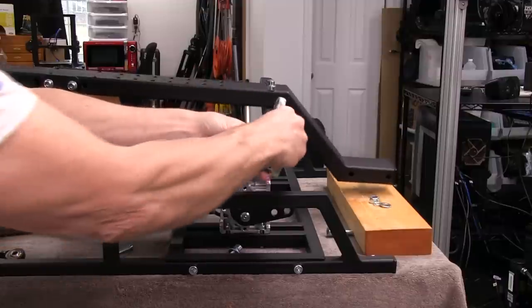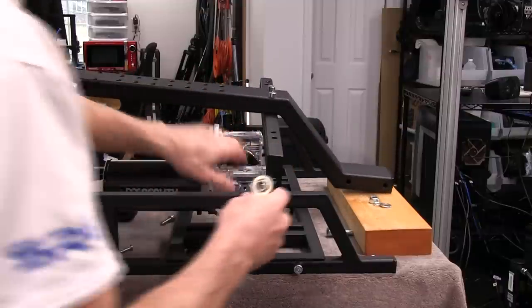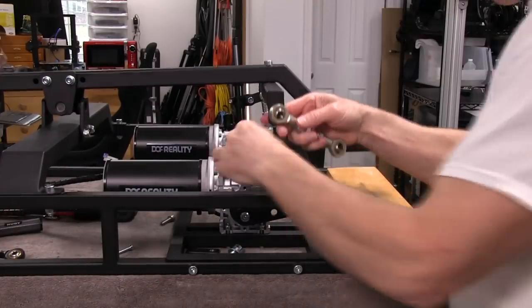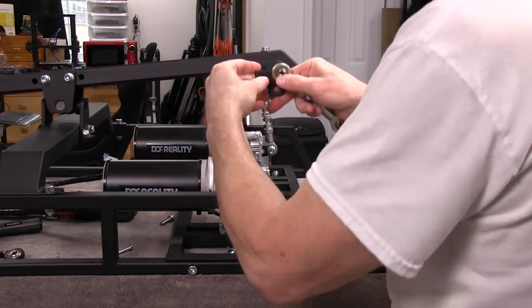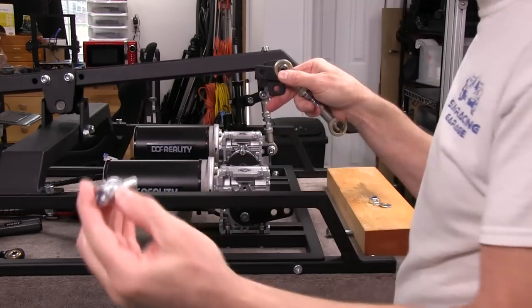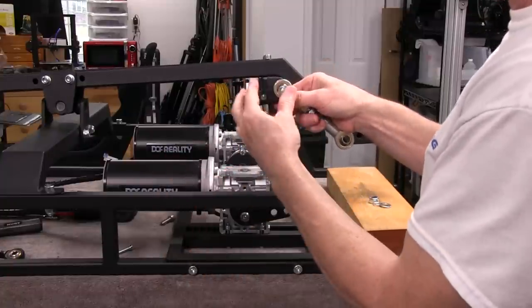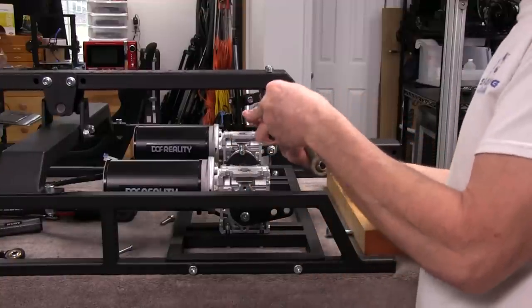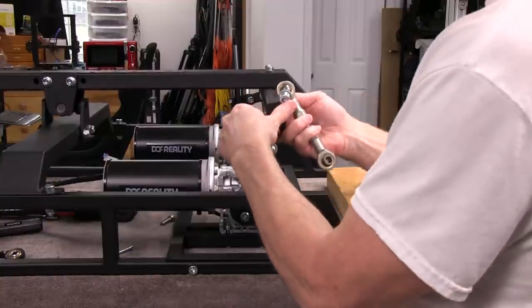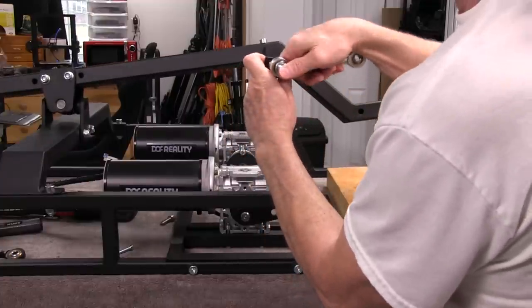Okay, simple, right? So what I'm going to do is go ahead and attach this first to the top here. All right, so I'm going to get my bracket behind there, and I'm going to use the bolt with a washer. This is our M10 bolt that goes into the rod end tops, just like we saw before. Just put that in the rod end, little eyelet there, and then we'll get our bracket to go on there. Okay, bracket's on,